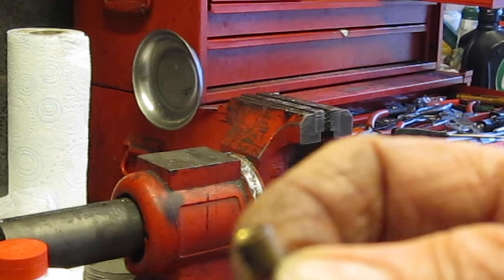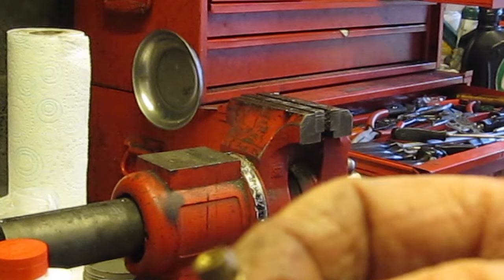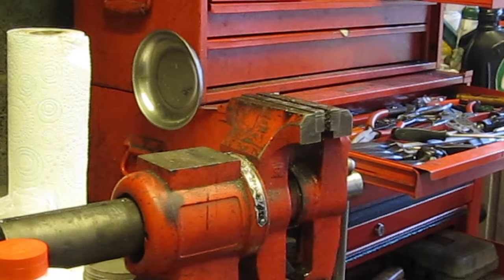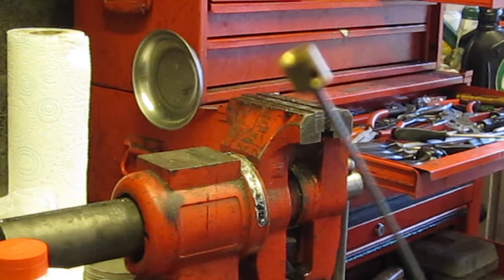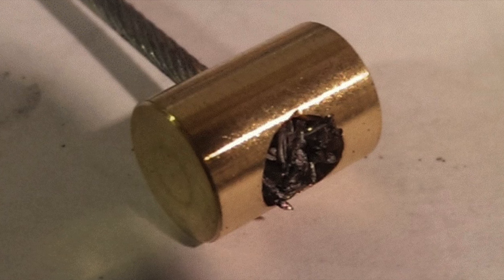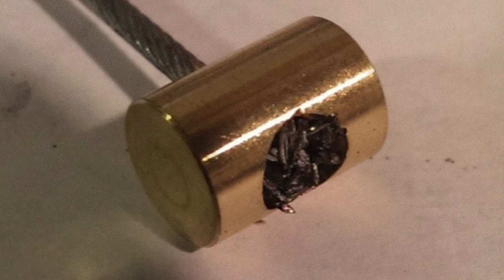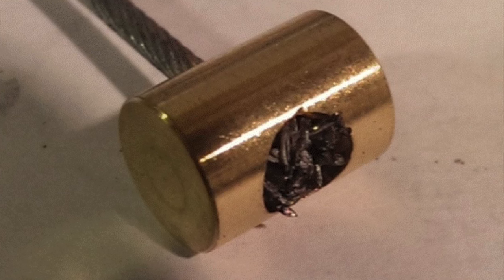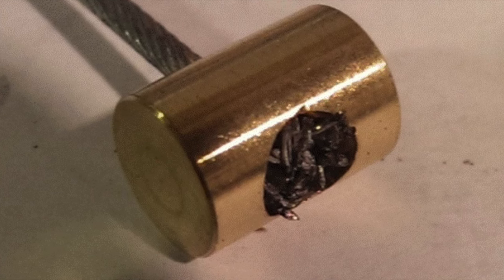This particular nipple I'm using is one I've modified. It's actually a nipped-down nipple with a grub screw, but I'm going to solder it on. This photo illustrates how the cable end has been spread to fill the back of the nipple aperture. Once this is filled with solder, it will make a very strong joint, preventing the cable from pulling out from the back of the nipple. That's what you should be aiming for.